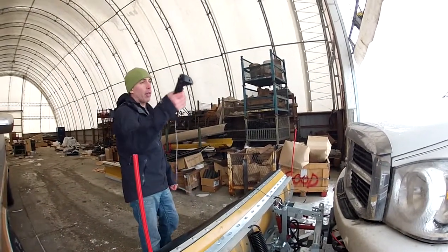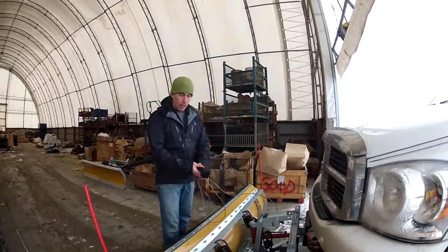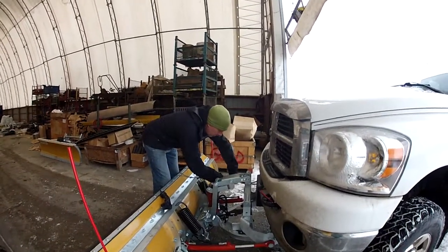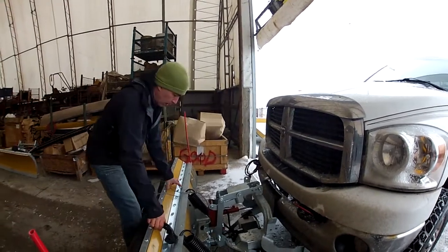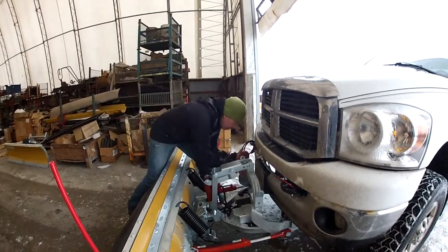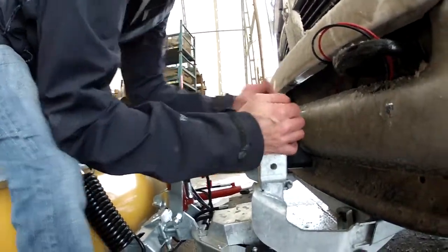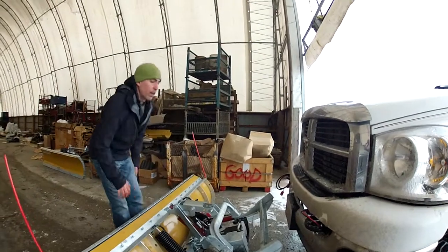At this point, feed the cable out through the window around the mirror and bring it out to the front of the vehicle. Hold it so it's not getting pinched anywhere. Put the blade in the down position, leave the switch on, collapse the front cylinder, then shut the switch off, unplug the control, and unplug the main power. Put the control away in the vehicle, then proceed to unclip. You may have to push back on the front frame to get the clips off. By relieving the pressure, there's no pressure on the linkage, so the front frame will float and those clips come off very easily. Pull it away from the vehicle and the plow is off.